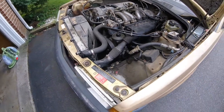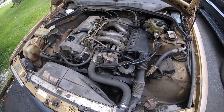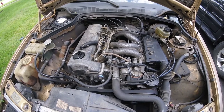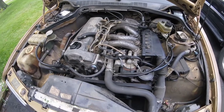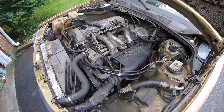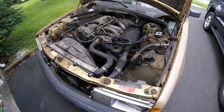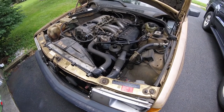Everything's back together. When it's idling it's great — there's no extra shaking. When I shut the car off it does shake a little bit still, but I think that's due to the fuel shutoff valve. If that gets a little weak, it's known that it can delay the shutoff, and by delaying the shutoff it causes a little bit of extra shaking. So I'm going to do a vacuum pump test on that and see whether that valve needs to be replaced or not. Overall this was a success — first job on the Mercedes, got it done without really any issues. Hopefully this helps you guys as you replace your own motor mounts. Thanks for watching, and I hope to see you in the next video.